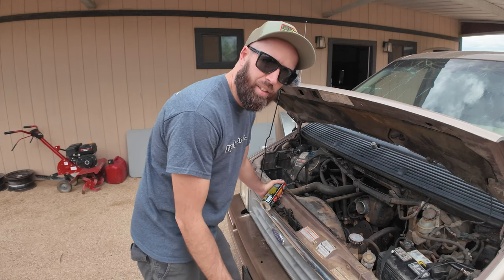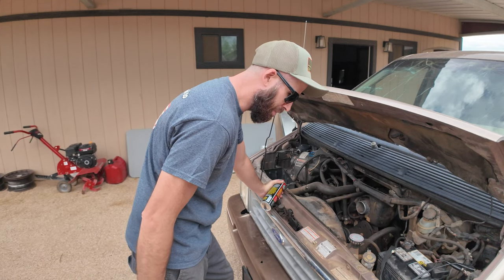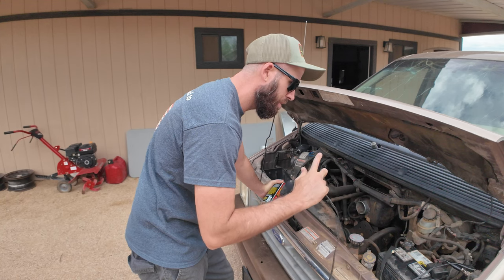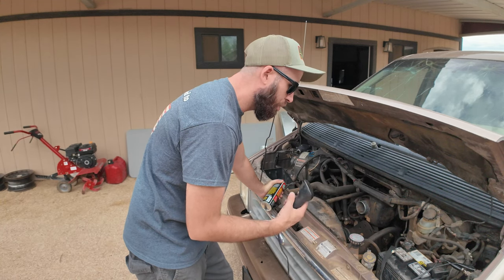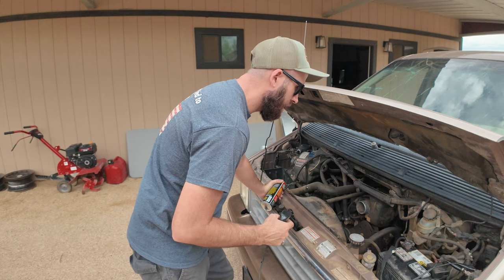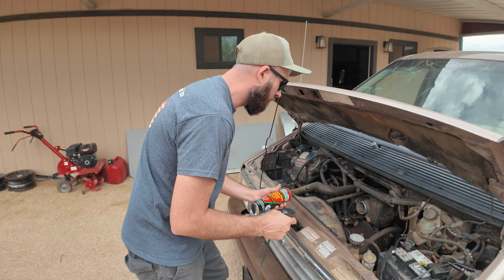Maybe we can drive this thing around. 3 liters in the Taurus were fun. 3 liters in this thing, fire hazard. So when you turn the key on, the fuel pump primes. So it's not the fuel pump unless the pickup's clogged or the tube between the top of the housing down to the pump is eroded and it's just sucking air, or the fuel filter's clogged, is what I'm leaning towards. But let's see if it fires off with some stuff down the intake hole.